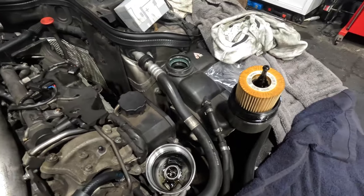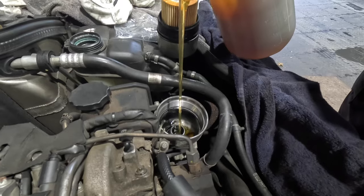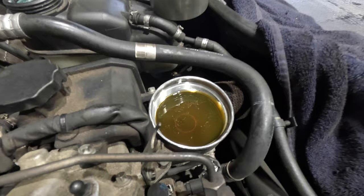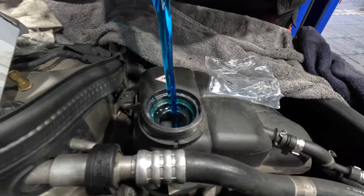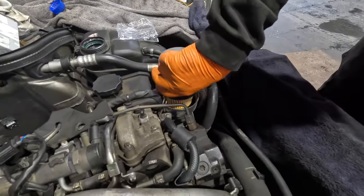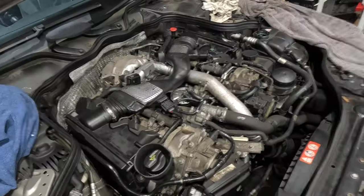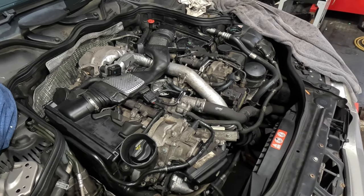All built back together with a new filter to go in. We're pouring oil into the oil filter housing to prime the turbo - it goes down really slowly, but this gets some oil around the system. Fresh coolant in too. We're ready to fire up - we've given it a couple of primes already. And there we go - nice.